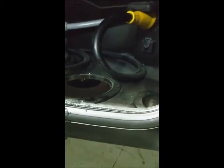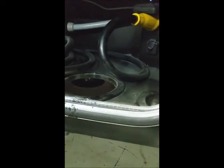Also notice on the floor of the compartment you have these lids here and here. You can run your power cord through this hole, so that way you can keep this compartment door closed while you're at your campsite. Also, you have a park cable connection here, so if the park you're in offers cable, you can run your cable up through this smaller hole, plug it into the park cable connection, and then turn your TVs on cable through the channel settings and run an auto channel scan, which we will cover inside, and that will pick up the cable and you'll be able to watch the cable throughout your motorhome.